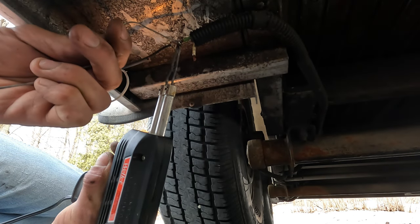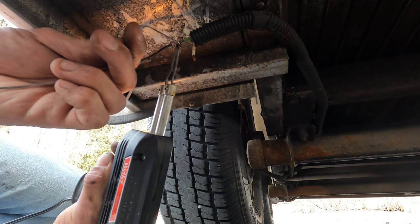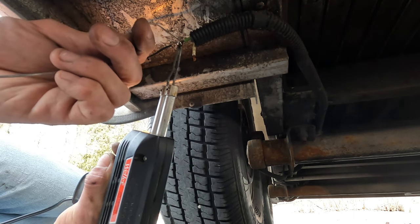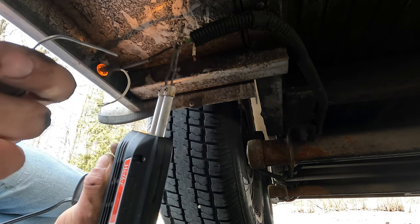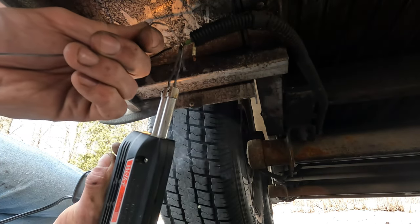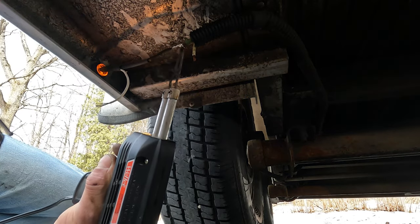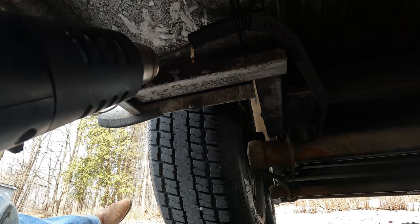Rather than reuse the Scotchlok connectors, or use crimp-style butt connectors, I prefer to solder the wires. Overhead soldering kind of takes me back to the days of overhead welding, with gravity not always being your friend. So with that connection soldered, time to add the heat shrink.